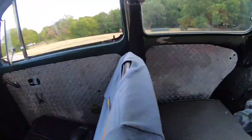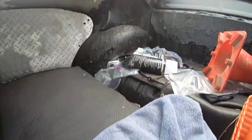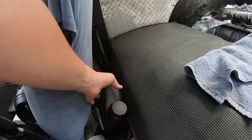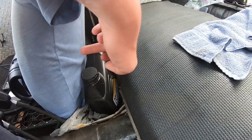Back there are my traffic cone for when I break down, wheel chocks in case you have to change a tire, and a towel for the steering wheel because it's Texas and it's summer, so it's hot. I also have a spare set of plug wires, my spare accelerator cable, spare clutch cable, e-brake boot, and oil. Since this car does leak — Volkswagens leak, it's common — I use Mobil One Delvac 15W-40. It's diesel oil so it has more zinc, and the 15W-40 is thicker, so with these cars leaking it may leak out a little slower.